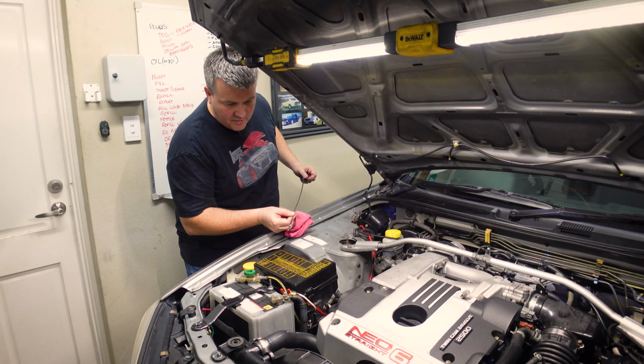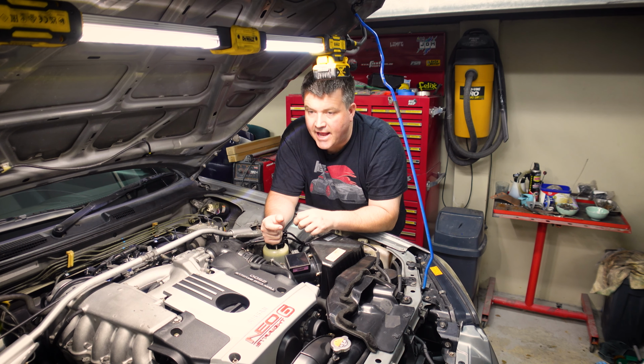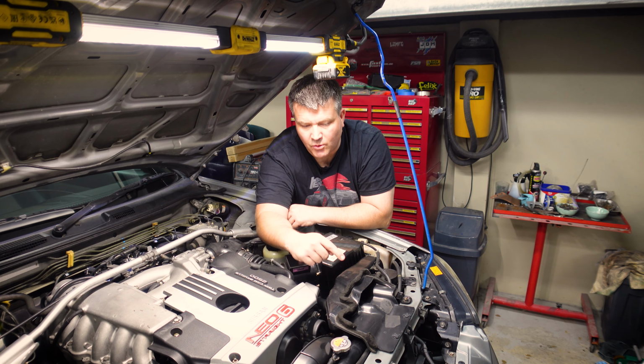Now for the next bit, what we want to do is break the circuit of fluid and basically have an outlet and then an inlet. And that will enable me to make sure that the whole system is flushed, so the torque converter, all of the radiator, all of the lines and everything. So what I'm going to do is take out the line which is down the bottom of the radiator cooler. So it's the long hose that goes all the way to this side of the cooler. I don't know whether that is an outlet or an inlet. So we'll have 2 open pipes, and when I start the car again, fluid is going to come out of one of those. So that'll be our output pipe. And then we'll start pushing good fluid in to replace what we've lost. And we're going to use 2 buckets to do that and a pump.